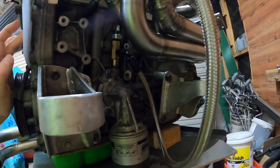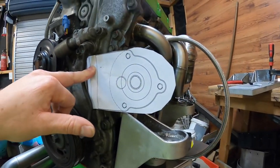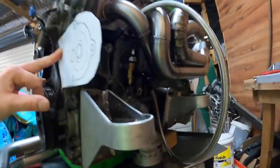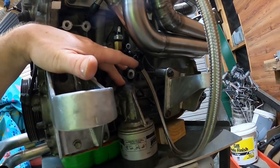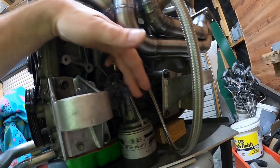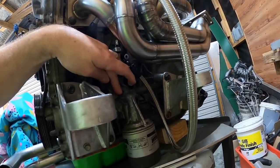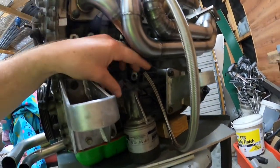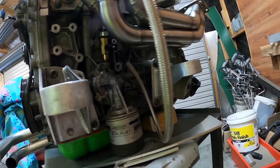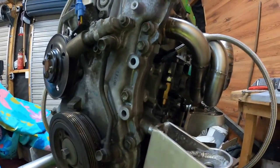So instead of that hanging there, it'll hang off the front of this bracket down the front, makes it easier to service as well. When we took this off, it looks like you can actually screw a filter straight onto the block if you take the threaded barrel out of there and put it inside the engine block. But then taking an oil filter off of there is just going to let the oil drop on the ground, so also it's hard to get at where if it's out here. It's going to make it easy.